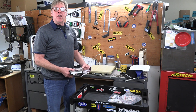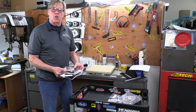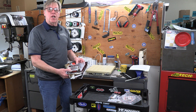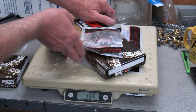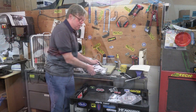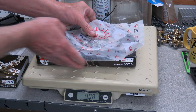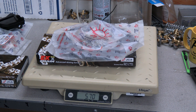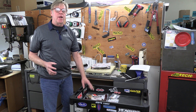Let's look at the weight of chain and sprocket sets, especially in the 525 size. A 525 chain and sprocket set in a common 15/42 combination weighs in at 7 to 7.5 pounds — that's a lot of mass going around. The same gear ratio of 15/42 in the 520 upgraded size weighs 5.7 pounds — greater than a pound and a quarter of weight savings. Reciprocating mass means the faster you go, the more inertia created, the more it tries to steer the motorcycle with a gyroscopic effect. Any opportunity you have to upgrade to the 520, absolutely do it.